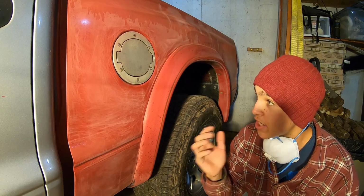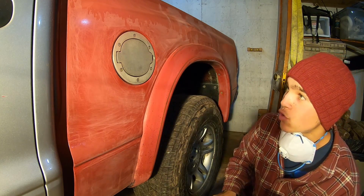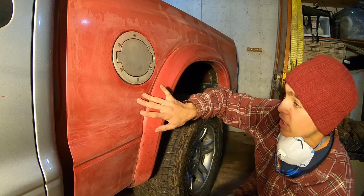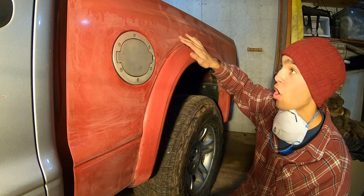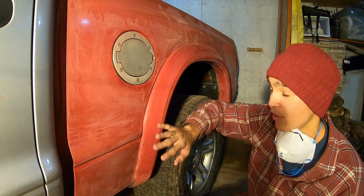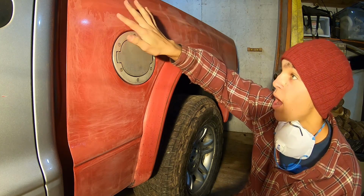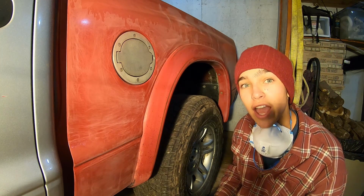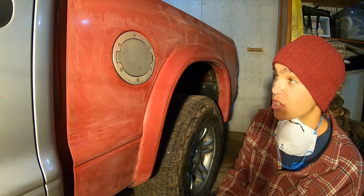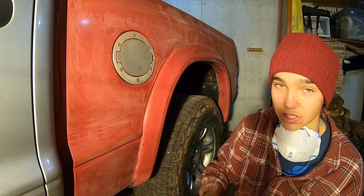All right, guys, so I actually just went over this all with, I think it was 120 grit. It was fairly coarse, nothing too crazy. Now I'm going to use, I think, 300 or 400 grit, it's one of those two. And I'm going to go over it again. As you guys can see, where the clear coat was chipping and peeling here, it's all smooth. It doesn't matter how scratched up it is, because you want it to be smooth to the touch for the finished product. For example, all this clear coat where it was peeling, you could feel the ridges, but now it's nice and smooth. And when I go over it again with the higher grit, which is the finer sandpaper, it's going to make it even smoother, so it should look good. And I'm not worried if I scratch this thing up, because I'm probably going to plasti dip that to match the bumpers and the handles and stuff.